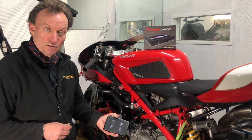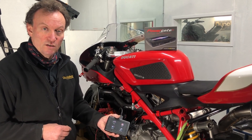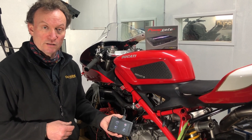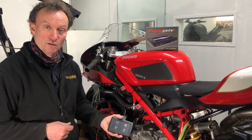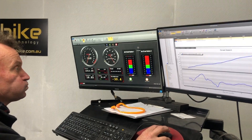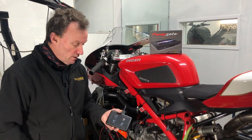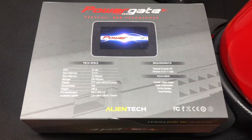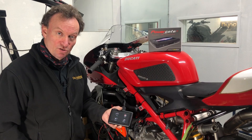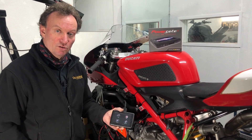You can keep adding tunes should you wish to - there is a small fee to add extra tunes. For example, if you change the air filter and air box configuration, you can take it to a dyno, do some runs, supply some air-fuel ratio readings, and then we can look at those and adjust the tune accordingly and send you a new tune. It's pretty flexible and a fairly useful tool, whether you want to go back to the stock file or load a different tune.